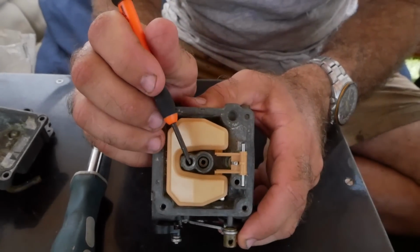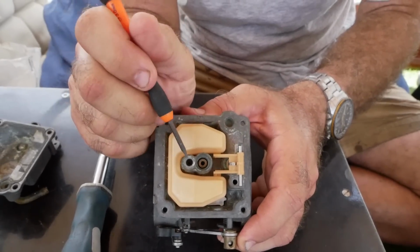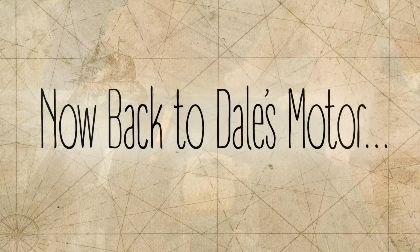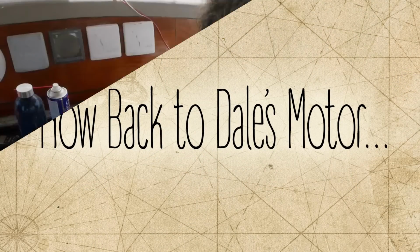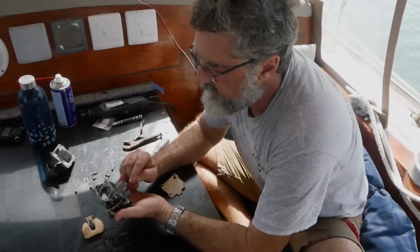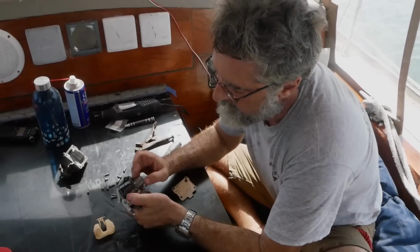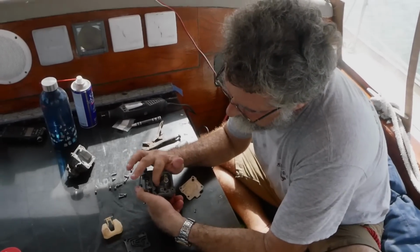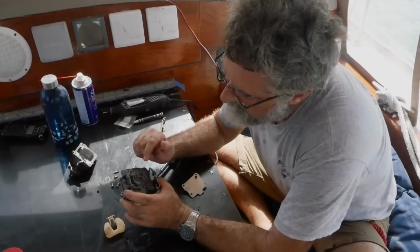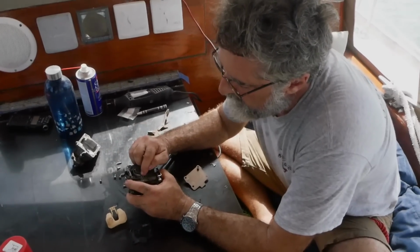It's just two jets. Jets are just plugs with little tiny holes, and that's all. The fuel comes up through, I don't know, one of these holes. I forget which one. It's metered on its own jet, but it's underneath this thing we can't get to. So we have to hope that that's not plugged up. Comes up that little riser there, I believe, so it'll come to here. And then it goes around this labyrinth and ends up coming out here.